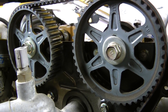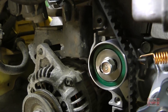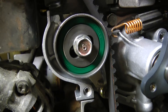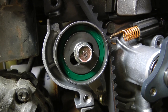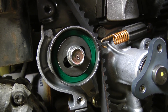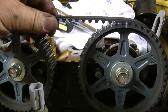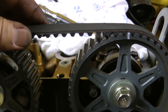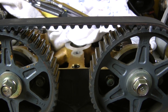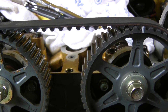Gates talks about rotating the engine over several times, then setting it at a certain location, loosening off the tensioner, and then tightening up the tensioner, rotating it over almost two more turns, and then checking the belt tension with a spring weight. The belt tension is actually measured right up at the top of the belt run, so I put a spring scale on there, pulled up on the belt, and measured the deflection.